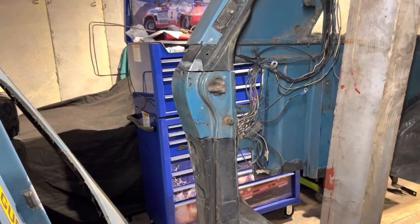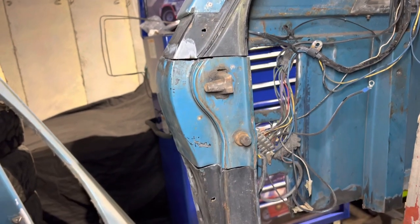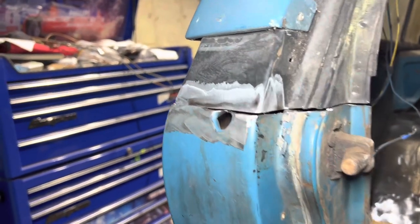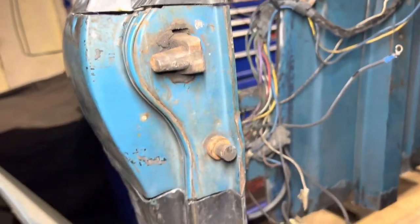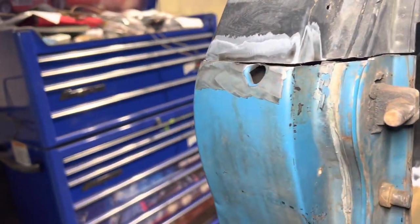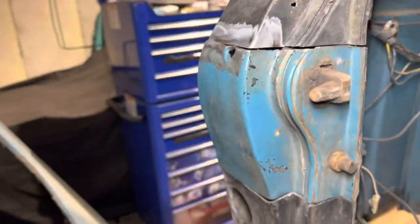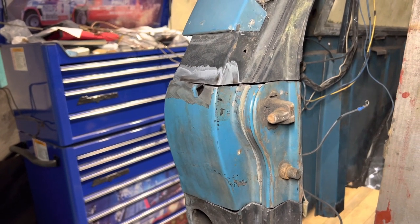As a first cut, that's come out pretty well - I'm really happy with that. Obviously it still needs a bit of fettling before we get anywhere near welding it in. We need to open up the joins a little bit - you can see it's a little bit too tight here. But around there, that's pretty much what you'd want - about a millimetre gap at the top and bottom of this panel, because when you weld it the metal expands and you can start buckling it. I'm pretty happy with how that's come out.